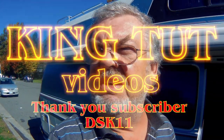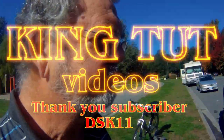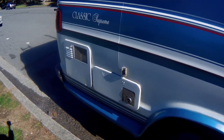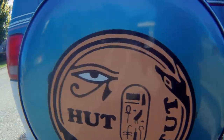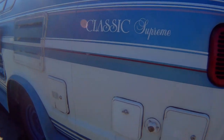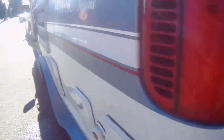Today I thought I'd start doing the winterizing of the van for the winter. I drained all the water from the tank, drained the water from the heater, turned all the valves off, and put some of that antifreeze stuff in, and drained the holding tank.